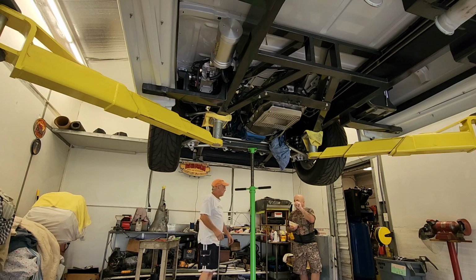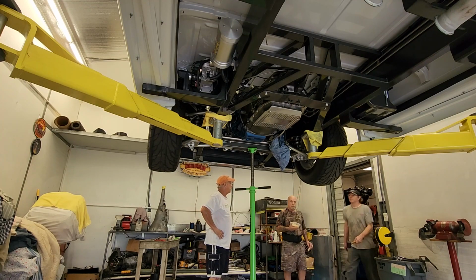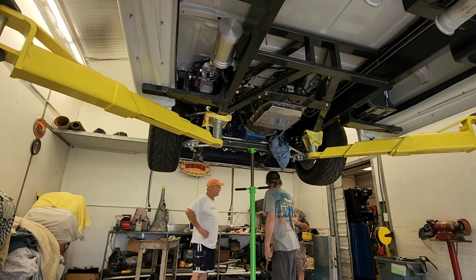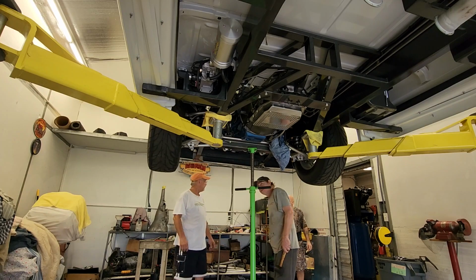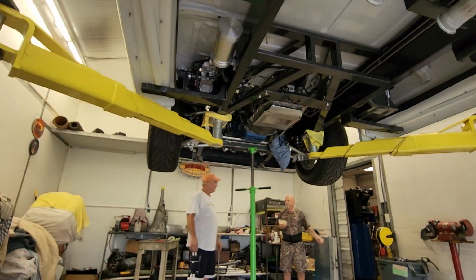Sounds like it might be a little taller cam. Both E303s, exactly the same Ford Motorsport cams. It's a street cam. Well, what kind of rockers did he put on? We got Chevy rockers on this. We got 1.7. 1.55? No, they're more than that. 1.7, I put the Scorpion roller rockers on. He didn't like them. He hated Scorpion. Who's that? Vic. I already liked him, I never had a problem. I understand what he's saying if you're turning like 9,000 RPM, but none of us ever do that.